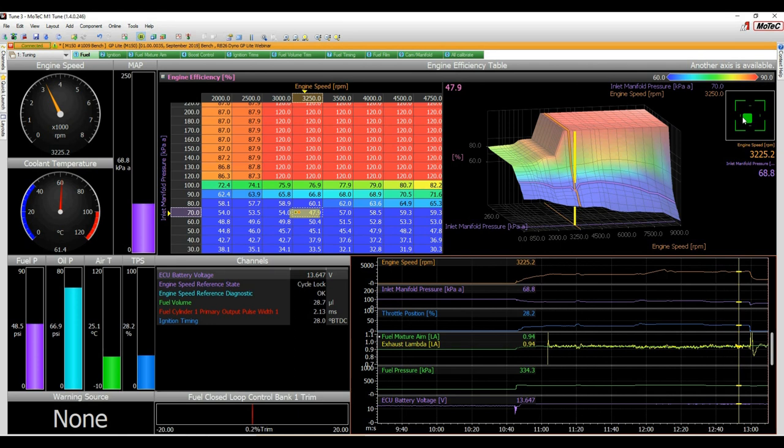So really the process, without going through the whole thing, is to go around your efficiency map at places where you can control, and quick lambda it or adjust it by making the numbers bigger or smaller, whichever suits your method.